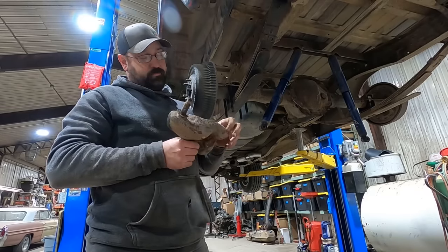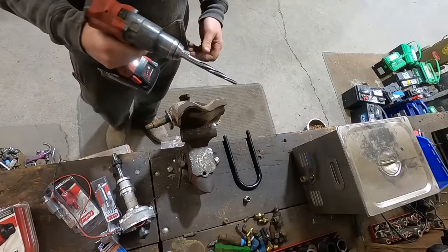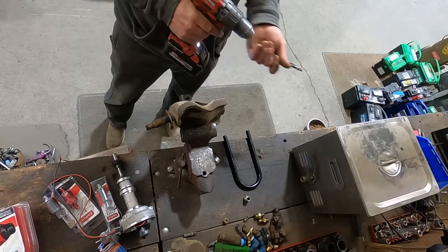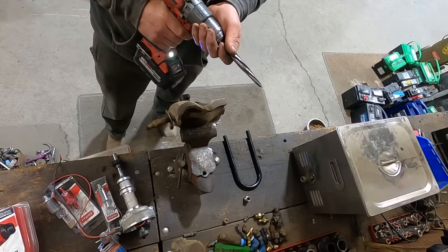Let's open these things up to half inch. I'm going to grab a bolt to take over there with us so we know when to stop reaming. In worst case Ontario, we just throw these things away. Or we can always weld up the holes or buy different bolts. Anyway, we're not out much. It's worth a shot. Conveniently, we have a half inch reamer. Okay, never mind. These are like 5/8. Conveniently, we have a 5/8 reamer as well.